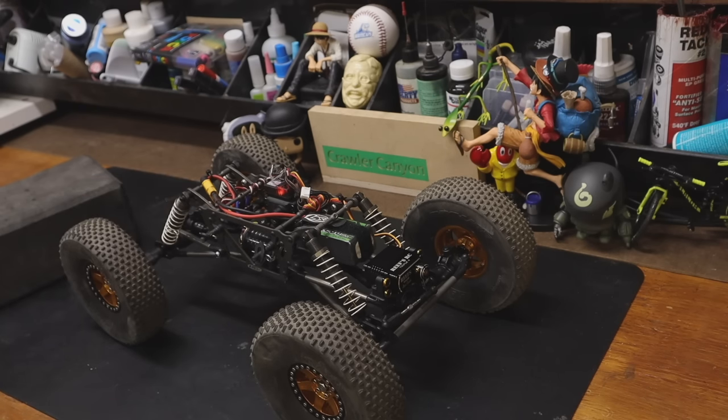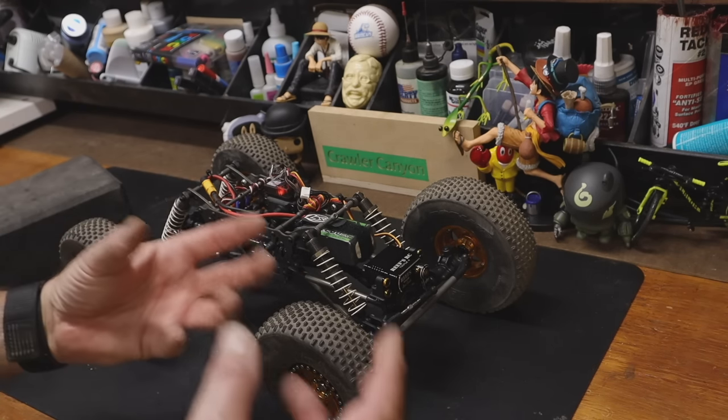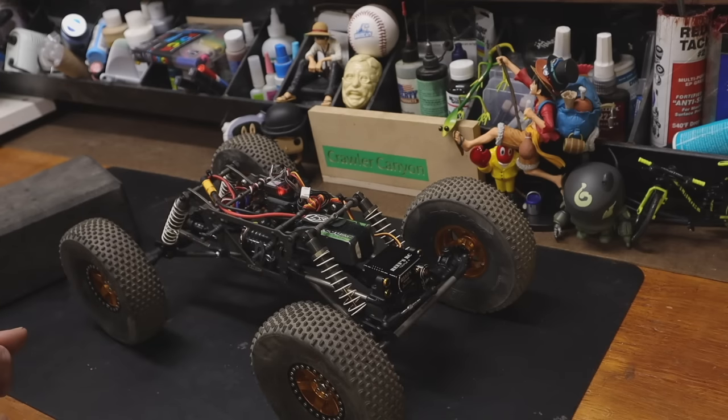This counts as a 0.5 because I was driving it and I was like, turn off the drag brake. So I turned all the drag brake off, turned it down to zero, and now it doesn't get hot. Or at least it didn't. I'm still going to put the temp gun in my pocket for this run. Yeah, there we go.